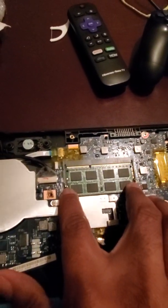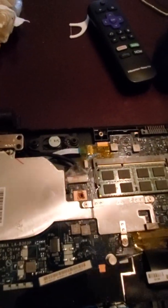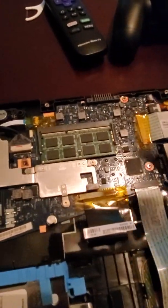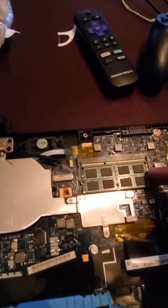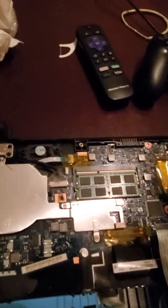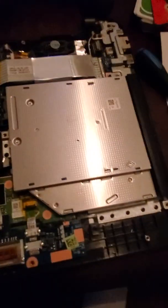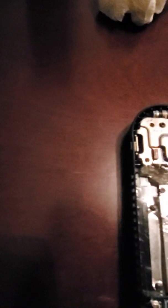Push down and it sits in. Some laptops might have two RAM cards, maybe on top of each other or side by side. Sometimes your laptop runs slow because you've dropped it and the card is just loose — so sometimes you can just open it and reseat the card. I did that, and it was still running slow. When you're done, you can carefully blow out any dust — this looks pretty good to me, no problem.